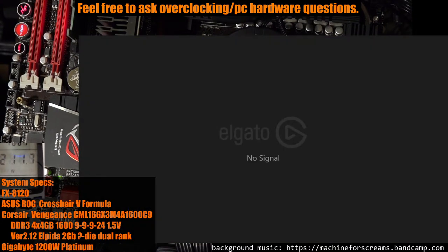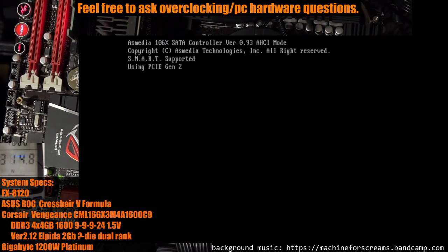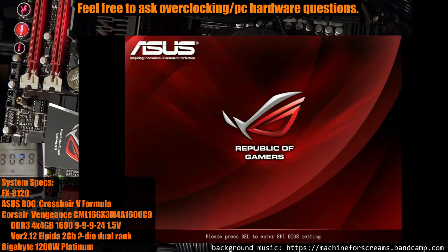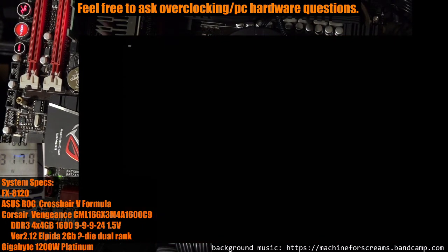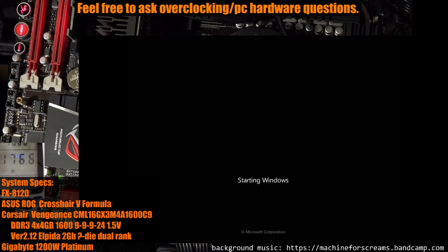Interesting that it keeps throwing random uncorrectable errors. I still think it's just the core crashing, because I pulled two memory sticks and that doesn't seem to have made any difference. Yeah, but it didn't throw up the clock interrupt not received. It's temp sensitive, probably. I mean, it's an FX chip. If they weren't temperature sensitive, they wouldn't scale so much with liquid nitrogen.